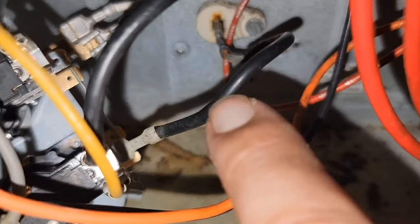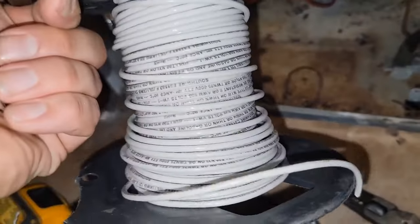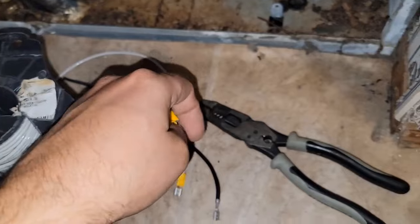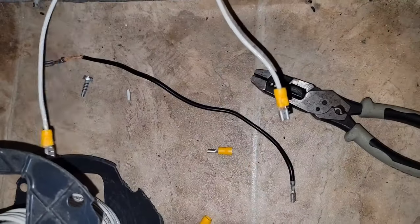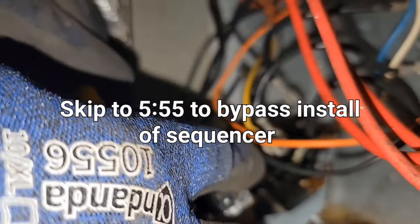Made me a wire. Found another burnt wire right here. I'm going to remove this. Make sure you carry some wire with you, and a couple spades. Got my wire strippers and my crimping tool. That's how I made this replacement wire. It went right here.